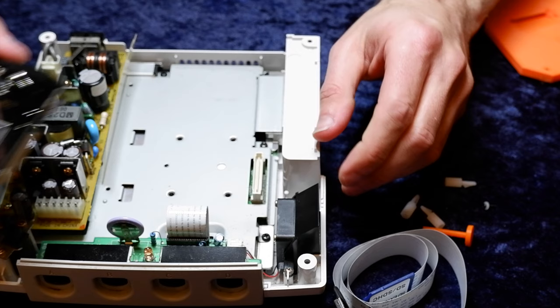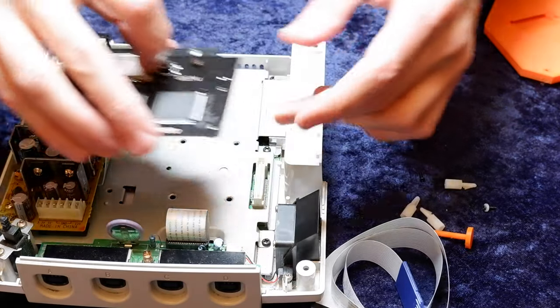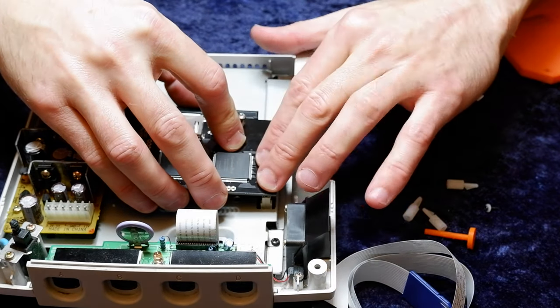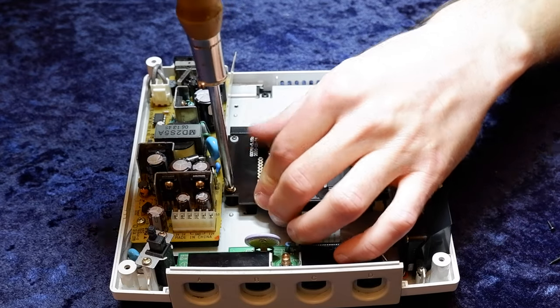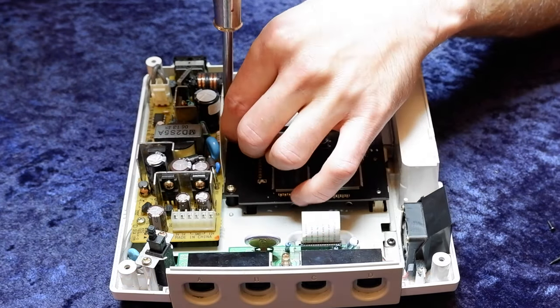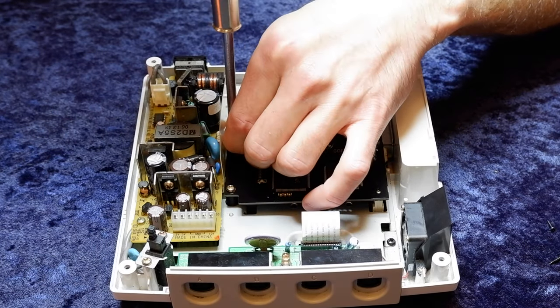The motherboard interface for the GD-ROM — and now the GDEMU board — is right here. You'll need to line up the plug on the bottom of the GDEMU board with the port on the motherboard. Once you have these two things lined up, just press down until it sits firmly in place — it should seat nicely into the port. Now use two of the original three screws that you removed from the GD-ROM to tighten the GDEMU board the rest of the way down to the bracket. This gives you a little wiggle room to make everything line up nicely in the case.